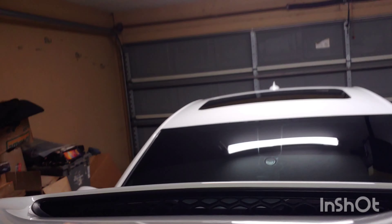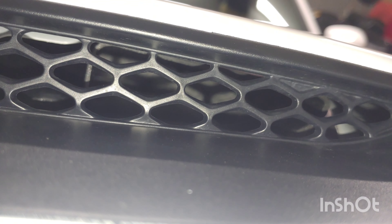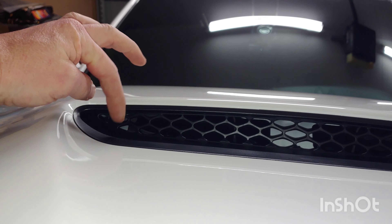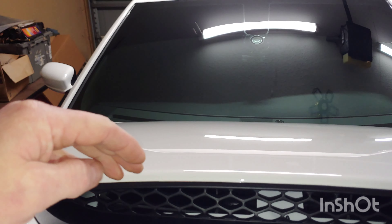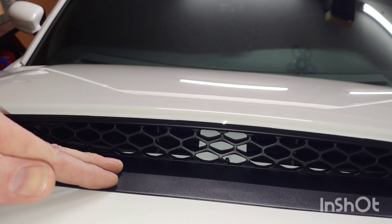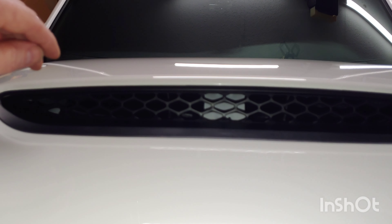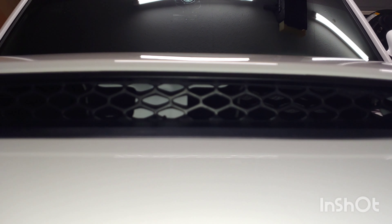We've cut these down, and I'm going to make a box here to completely seal all of this off. You can see up here where our snorkels actually come in. This kit comes with another insert for your hood scoop, but that insert is actually a lot shorter and a whole lot narrower — it doesn't fill the entire scoop. So we are retaining our factory scoop. These are easily pulled out if they're not cold. I prefer everything to be room temperature when working with plastic, because warm plastic won't crack — it's more likely to deform and flex, but if it's cold it's just going to break. There wasn't a whole lot of clearance issues, but I did have to bring about an inch and a half out of each side.